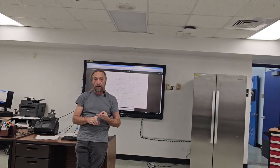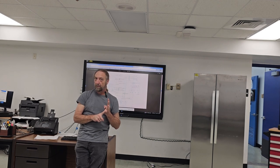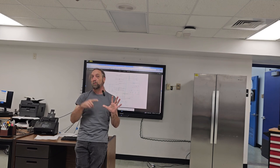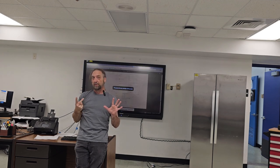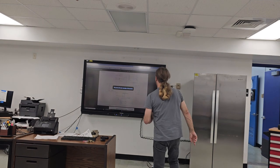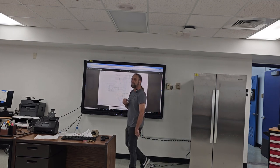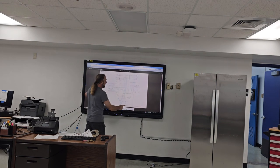Two on the refrigerator evap, one on the damper, one in the refrigerator compartment, one in the freezer compartment, two in the freezer ceiling, two on the evaporator, and the ice maker had its thermistors too. Now look at this diagram for this refrigerator — take a minute and see how many thermistors, or sensors as they call them, are on this diagram.